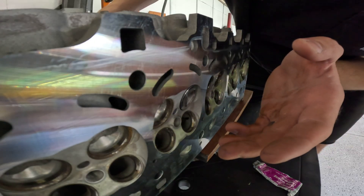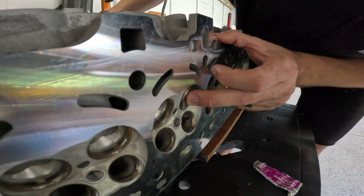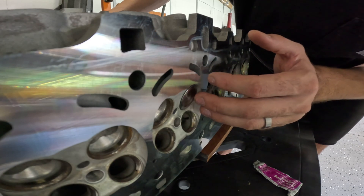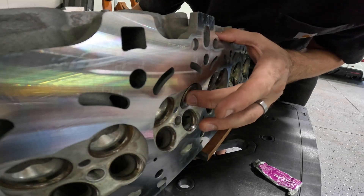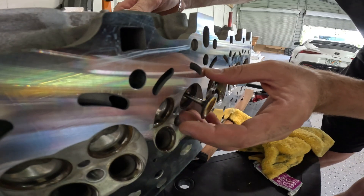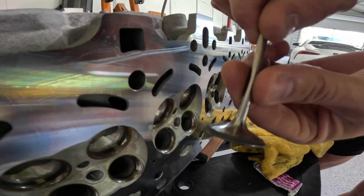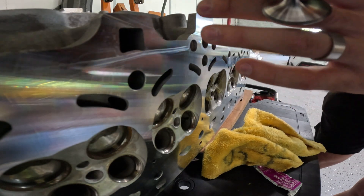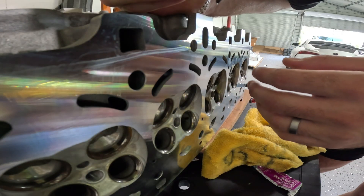After you've spun it right and left a few times, lift the valve slightly and then put it back on and do the same thing again. As you can hear, the grinding gets quieter as you spin it longer — that means the compound is breaking down to a finer grit. Once you get to that fine grit, you take the valve out, clean it, and check your work. One pass is enough. Sometimes the exhaust valves are a little bit worse than the intake valves, so probably two passes is more than enough.